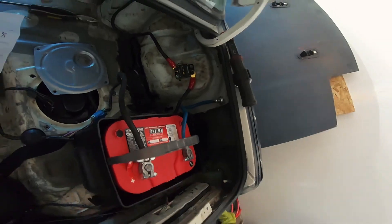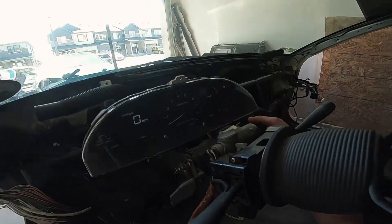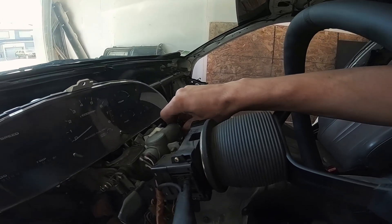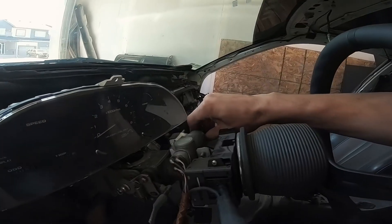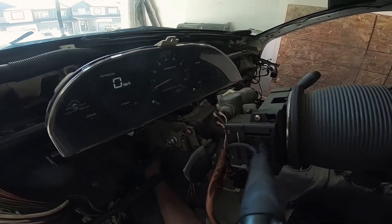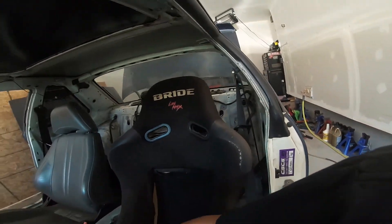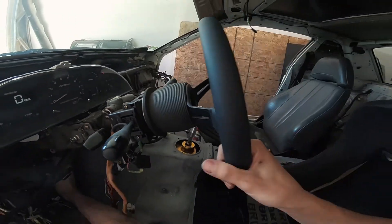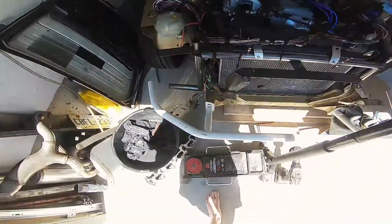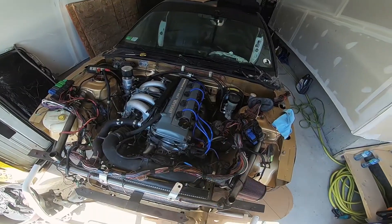There's going to be no leaking coming from there. Starting it up — got my keys. Giving it a little bit of gas. No, that doesn't sound good. It still sounded like it was leaking. So everything else is working, but damn — we're going to take the intake manifold off and put the old one back on because I'm assuming the leak is coming from somewhere through there.